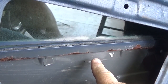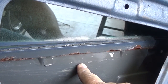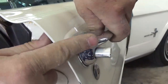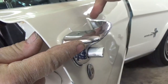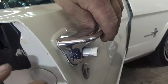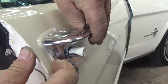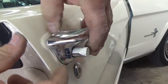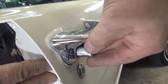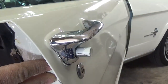While I have the door open, I'm going to change the rubber grommets on the outside handle. Taking off the door handle is pretty simple — there's a screw right here that goes into the handle which holds it, and then there's a screw or nut on the inside of the door that holds the other side. As you can see, the grommets on here now have been painted over, they're dry rotted, and they need to be changed just so they look nicer. While I have it apart, I can clean all this paint off — someone did a lousy job masking and just painted right over the handle.